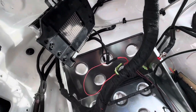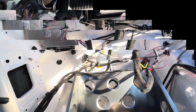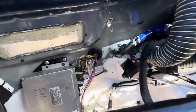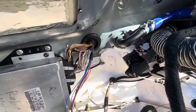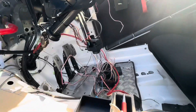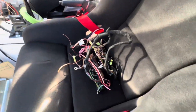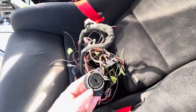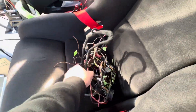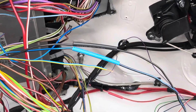I've got a big bunch of wires sorted out for inside here — looking forward to that. The ECU is all mounted nice and secure in the corner there. The wires are going through the bulkhead nicely. Time to sort out the interior loom — to go to the fuse box over there and keep the existing switches working. There's the rest of the loom I've got sorted out. I'm going to keep the diagnostic socket, which will feed information to the PDM via CAN.